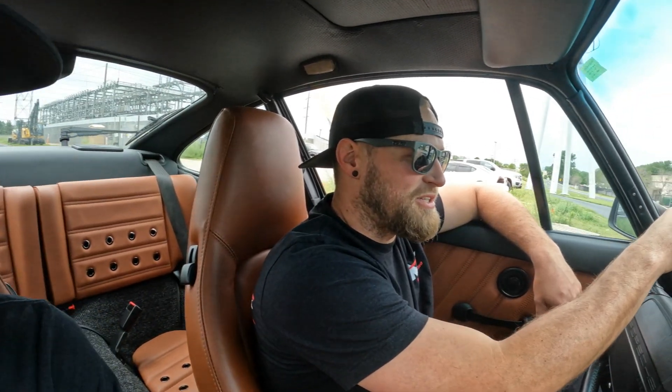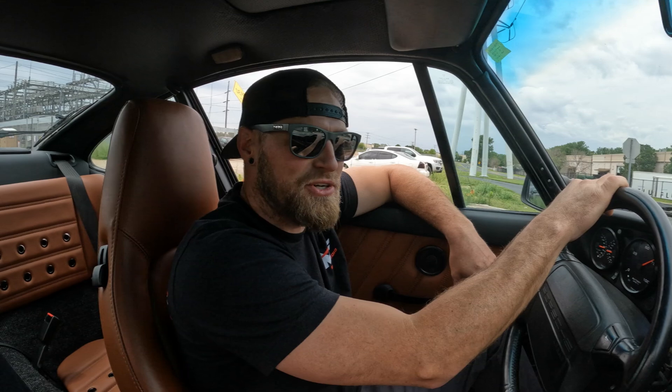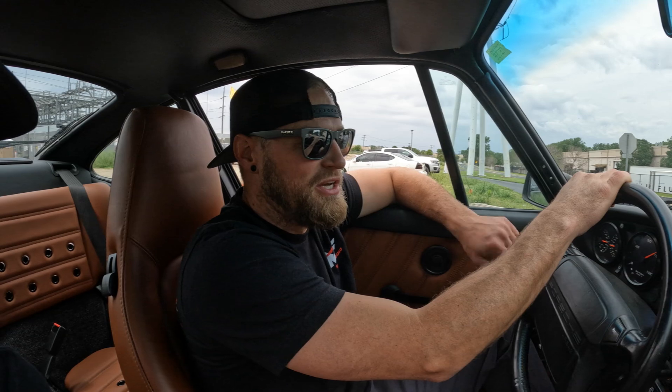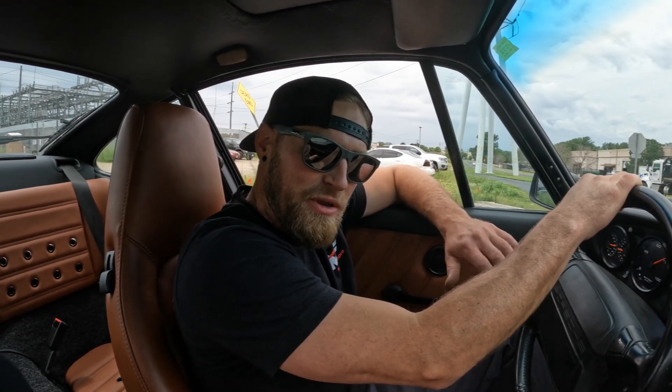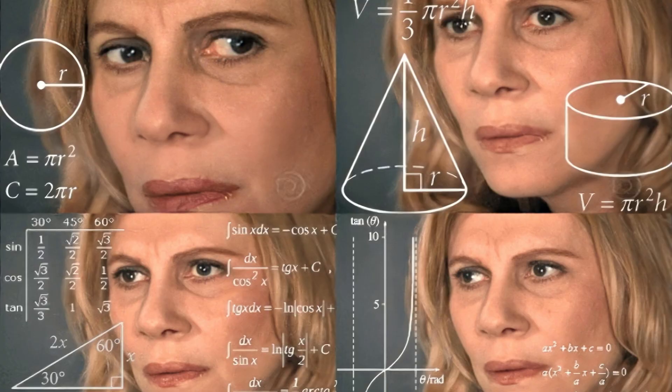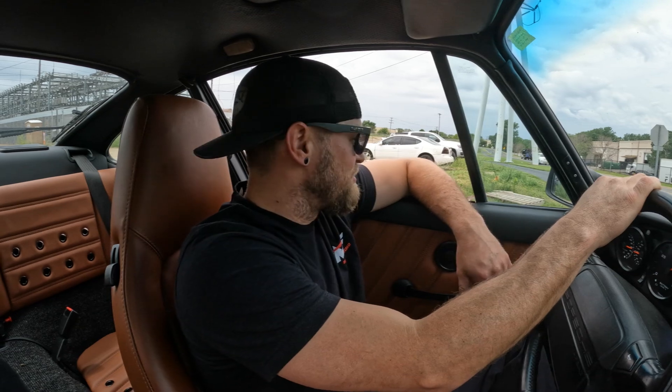What do we have underneath this Tesla basically? So this is a Tesla LDU, 16 batteries, aux drives. We've got about 75% battery load on this thing right now and we're actually de-torqued at about 350 newton meters versus about 450 that it would normally be good for. So there's definitely still some dialing and tweaking to do on this thing.